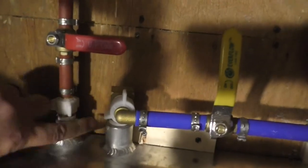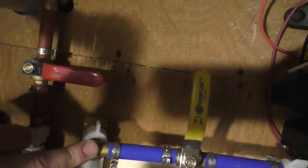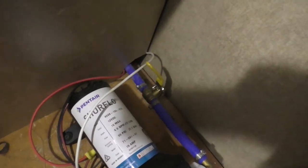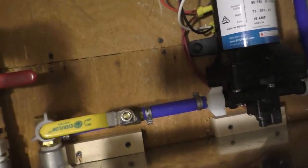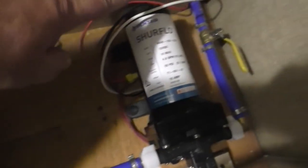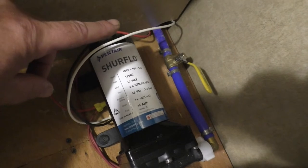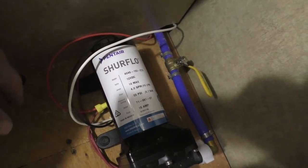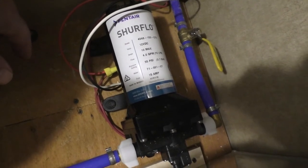This is your water that comes out of the tank, out of this brass fitting, into this PEX. There's a valve on both sides of the water pump — this one's a little harder to see. So you've got water that comes out of the tank, through a valve, into the pump, out of the pump, and then it goes down following the floor on the driver's side. Then it goes to your sink first, then your shower, then your toilet.